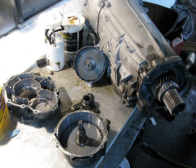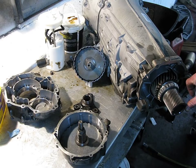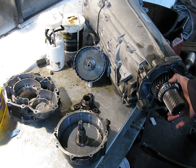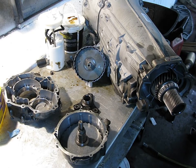The bearing, we're going to price this out tomorrow through our sources to find out the price and availability on the bearing. It's going to need a special tool, a bearing puller, to remove it from this shaft right here and to install it. And we will reassemble after we clean it up and everything should work fine. The car is in pretty decent condition.